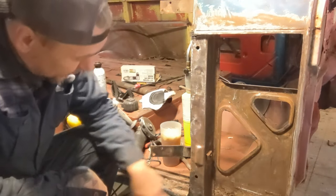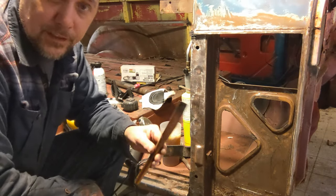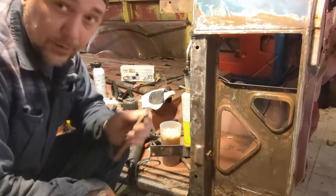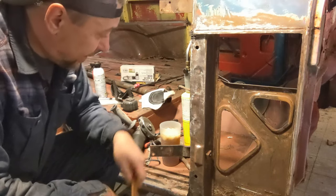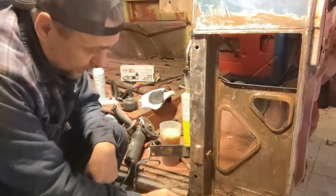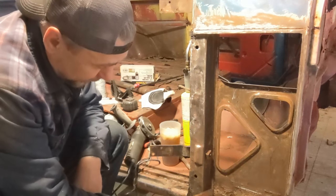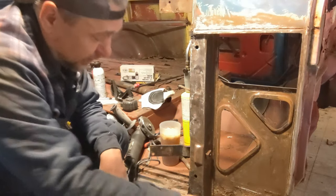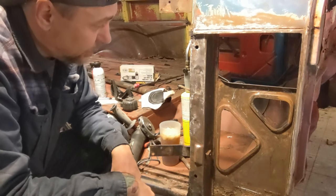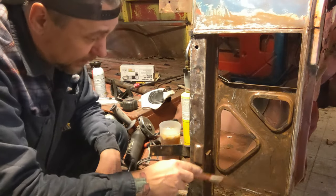I had some holes down through here. What I did was I went ahead and plugged them — I got this piece of half-inch copper, just flattened it in with a hammer and used that to prop up back there and backfill. It does get hot, so I need to make a handle for it one day. Checking things out down here, this area looks like somebody welded a patch panel behind there. I'm going to take the old cutoff wheel and cut off this old stuff to see what we've got, because I have a feeling we're going to have to remake this lower edge. Kind of got in here and cleaned some of this up, got it ready for primer, and then on to building the outer piece.